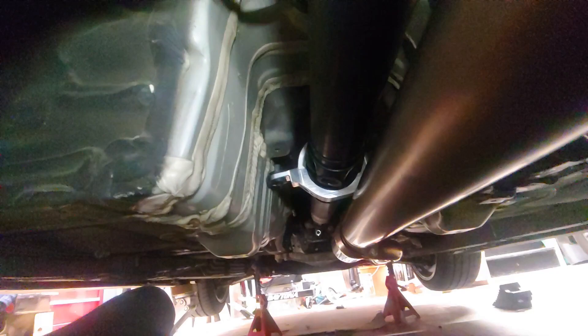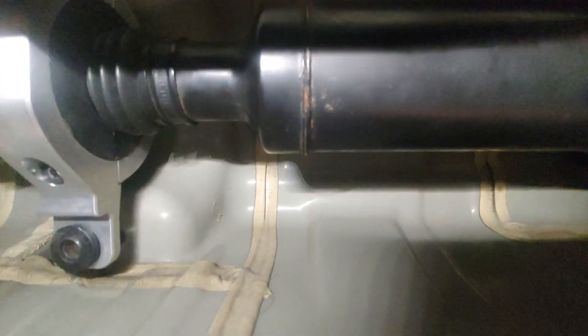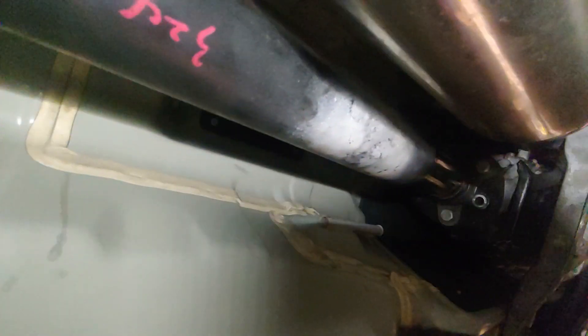You can see on mine that I've got that reinforcement on the front side and on the back side. I have my center support bearing loose and the bolts on that front one loose — leave everything loose until it's fully installed. When you look at this one, you can see I actually have a bolt that's out. There's my flange on this side, and even without the center support bearing in here, there is much less flex. It still is going to let them flex around because they're not fully bolted in.